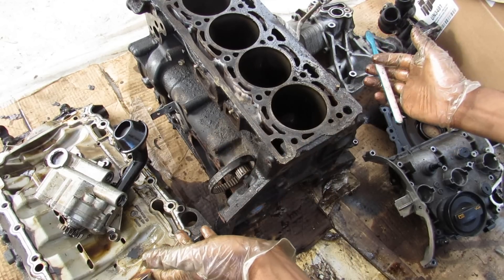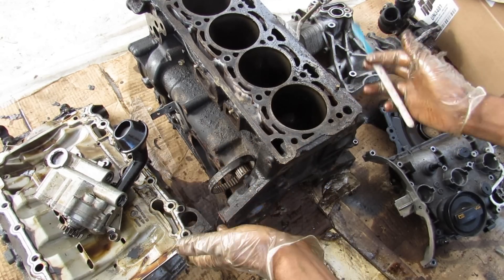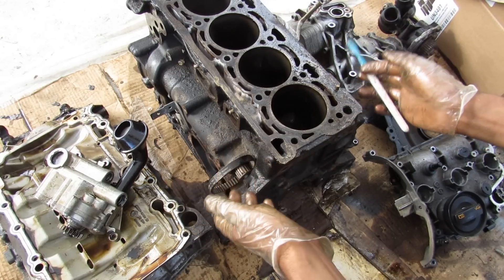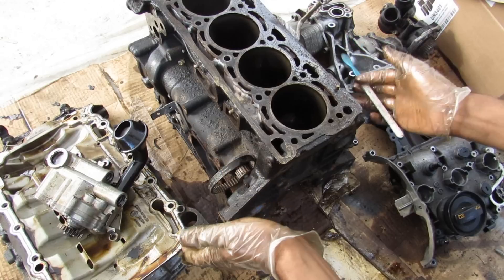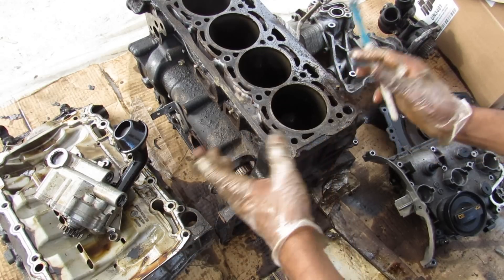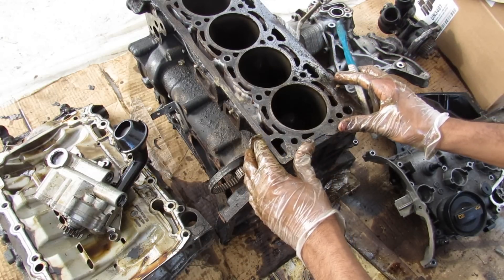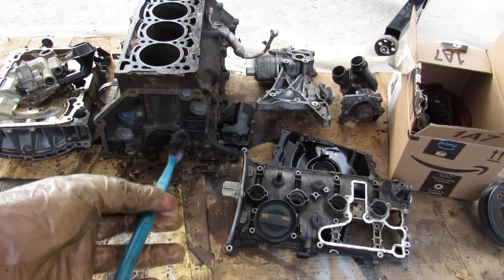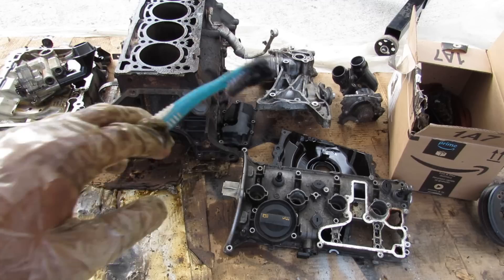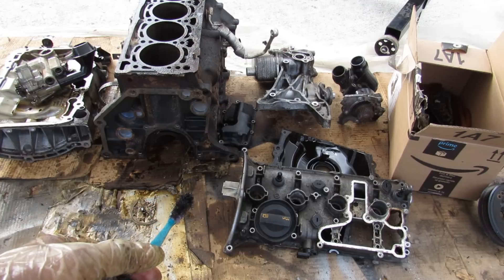One of the main advantages to this platform is that you can tune it — there's a lot of aftermarket customization, tunes, and bolt-on upgrades available to make this engine a really competitive performer whether you want to race it or just have a better road experience. Being an iron block, it can take a lot more power than an aluminum block, and if something catastrophic happens chances are you can still reuse the block. Keep in mind many of the flaws mentioned only affect some of the three generations of the EA888 engine and not all of them, so do your research to make sure the flaws have been corrected before purchasing a vehicle with this engine.